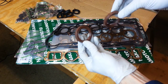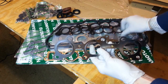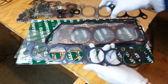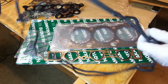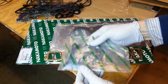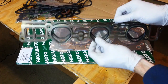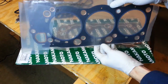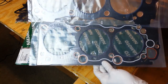These are the cam oil seals — one for each cam, goes right behind the cam sprocket. Exhaust manifold gaskets, left and right. These go on the intake plenum, upper and lower. Two new valve cover gaskets. Various coolant line gaskets. These are intake manifold gaskets that go on top of the heads. And last but not least, what we were actually here to take care of — our two cylinder head gaskets.